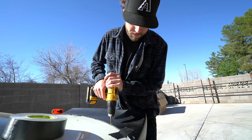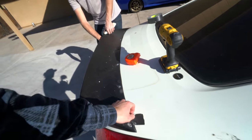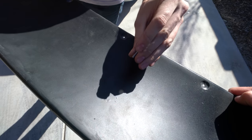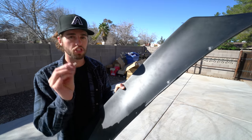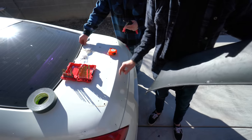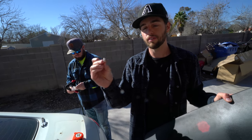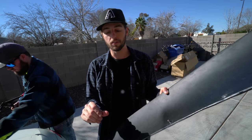Light pressure — don't break a drill bit like I just did. Just finished drilling the holes with a small bit. Now we're making sure we're drilling holes big enough for the top bolt to go through. We drilled the small ones, we just need a little bit bigger. The size you drill in the actual duck bill is just big enough for the hardware bolt on top, which is smaller than the hole you drill in the actual trunk. The hole in the trunk needs to be as big as your rivet nut — don't drill the rivet nut size in the duck bill, that'll be too big for your hardware. Two separate sizes — very important.